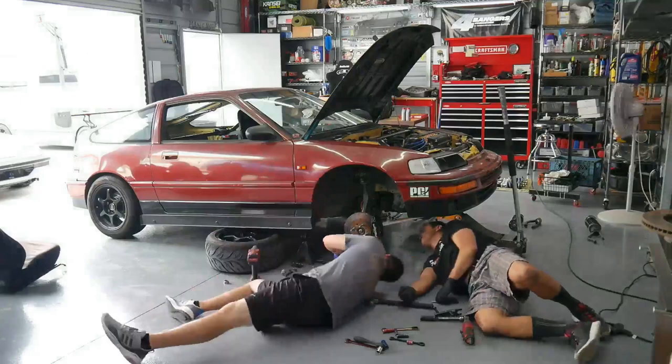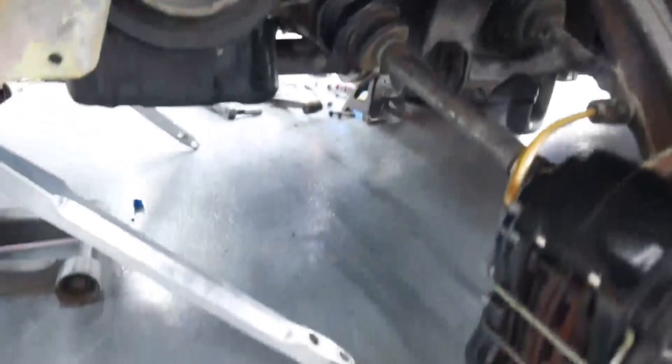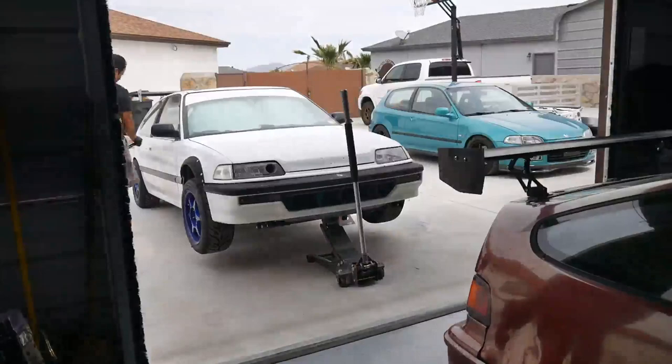Here we're just finishing up the passenger side. Chris needed help with the ball joint and didn't want to damage the buddy club ball joint, so he let me get that one removed. There's the new upper control arm bushings installed. Got the energy suspension with the stock LCA out, and here we're just gonna start removing parts off of the old Civic.